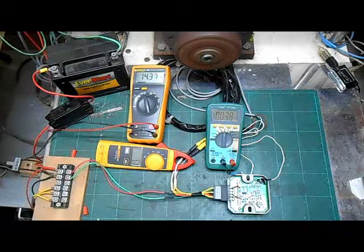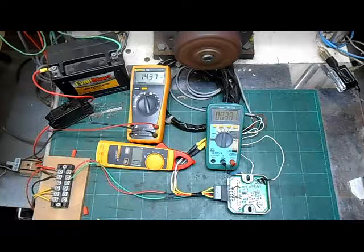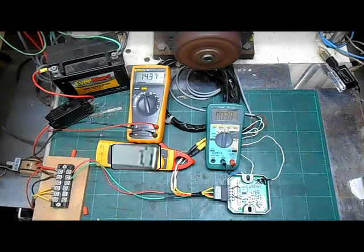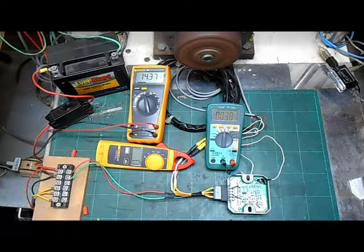We will pause it here for a second. As you can see, now that the generator has spun up, the regulator is controlling the voltage at around 14.3 volts. The temperature is holding, and there is about 1 amp through the stator. This is power that is going towards charging the battery. As we continue, we will turn on a light to simulate the bike's headlights and put more load on the generator.